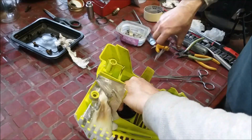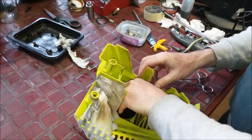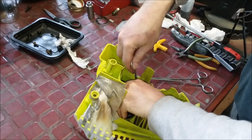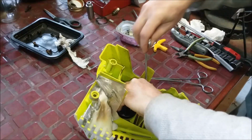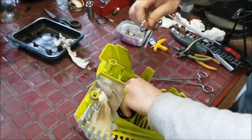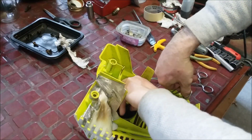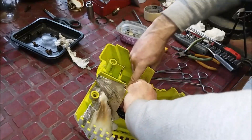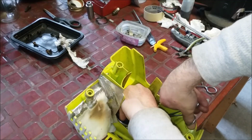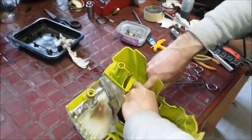So this one's a difficult one because there's not a lot of room. There's not a lot of room in here to kind of feed it through. Because it has to, yeah, twice you'd be doing it. And you have to try to just keep holding it. Should have grabbed my other needle and those pliers, because it comes through 2 sets of ferrules. Yeah, twice is more than enough. And then just keep feeding it outward. Try to hold it and get it out as far as you can. Once you get it through a couple of ferrules, you can pull it a little bit. Don't forget to give it plenty of excess.